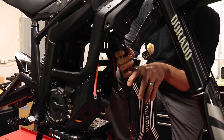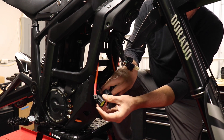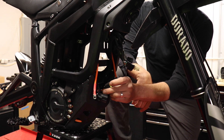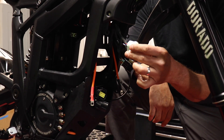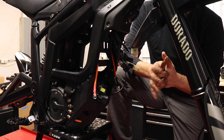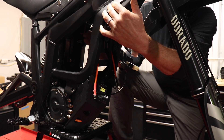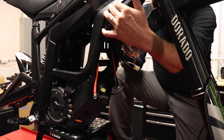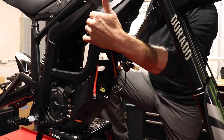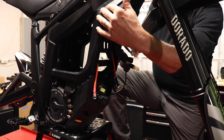Then you're going to be removing the power and phase wires with the 5mm hex bolts, removing the upper part of the harness, and disconnecting the motor connector right here. You'll also want to remove the 4mm bolts that hold the battery plate in place so you can pull the battery plate back — the battery plate is what the breaker is connected to.